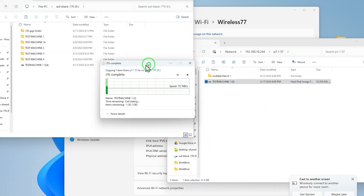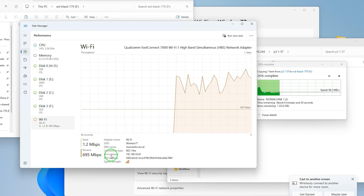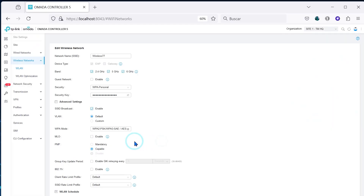In Wi-Fi 7 with no help from the AP, this MSI Wi-Fi 7 adapter transferred the same file in about seven minutes, but link as well as data transfer speeds were very variable — typical from Wi-Fi connections, you might say. So we went for multi-link operation.